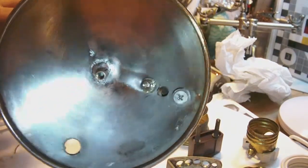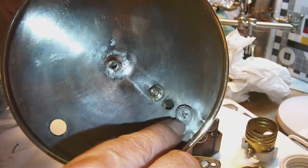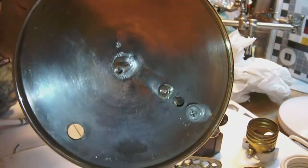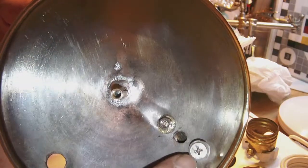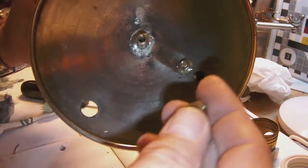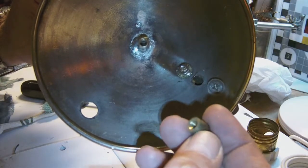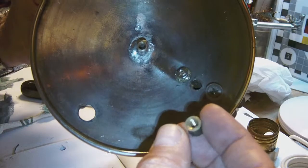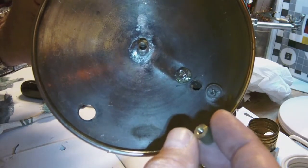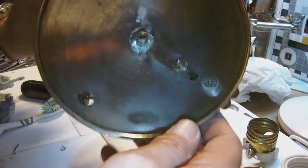All right, I managed to repair the attachment of the stem of the lamp. So as you can see, I cut a rust-free, stainless steel screw with a plastic washer. I couldn't find brass. I would have liked to find something like this, but I don't have any right now. Brass washers of say 5 millimeters inner diameter, I don't have. This washer would have been ideal had it not been 3 millimeters diameter. But okay, we managed with a plastic washer.